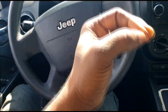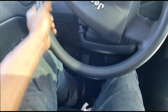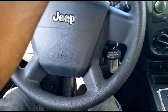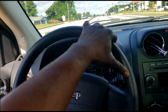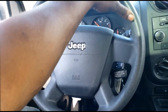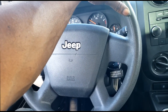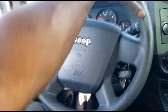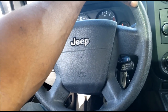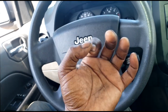I want to be on an alignment rack for this type of test. I want the weight of the car still on the ground but I want the front suspension off the ground - the only way to pull that off is an alignment rack. That is borderline dangerous. The danger in continued driving in this state is that bearing can essentially overheat and just shear from the wheel. Because it's bolted on with the axle, the wheel might not fall off but you can do some major damage. Do not continue to ride if you hear this noise. Get it in, get it checked out.